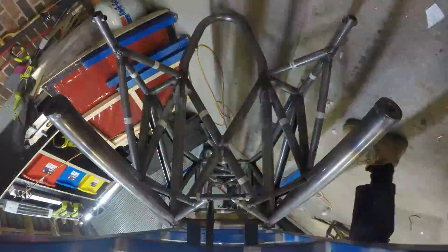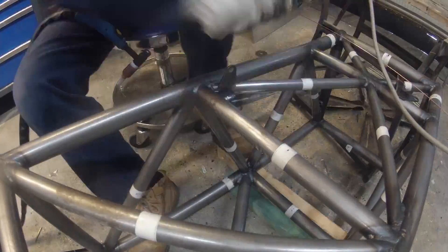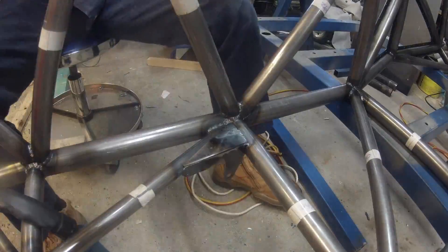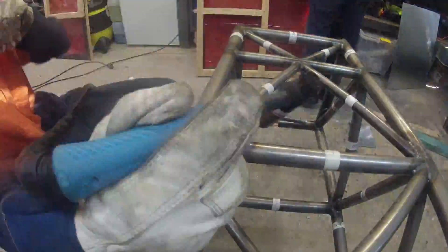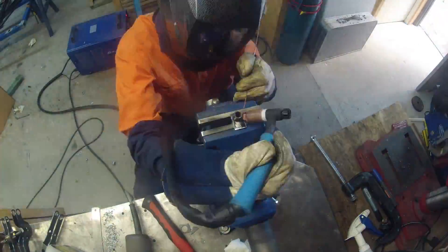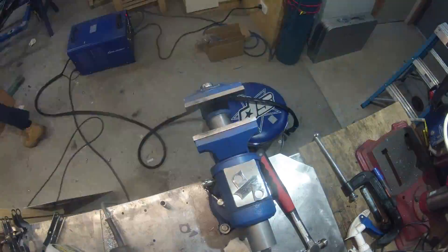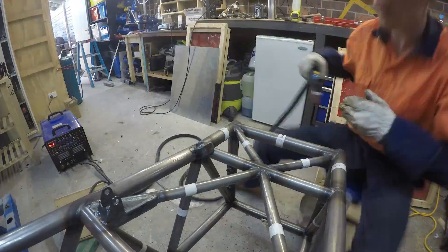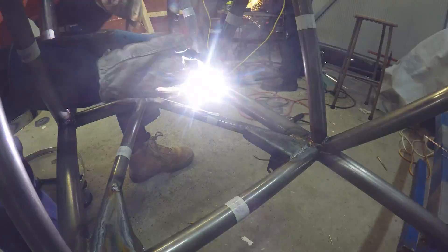From here it was onto the smaller mounts and brackets. The front damper mounts were first — these were made from laser cut steel that essentially gusseted a corner of the chassis and provided a standoff onto which the damper could be bolted. The bell crank mount was welded off the car as a small assembly. Having laser cut parts makes fabricating this way quite easy; the accuracy is very good so it almost seems like it puts itself together. Once the assembly was welded together I just had to place it onto the car and weld it around the perimeter.